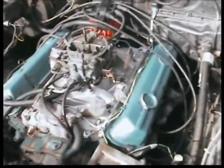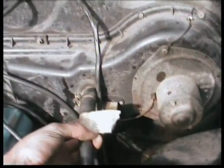We're basically unbolting the radiator now. It's compulsory to have a stubby of Melbourne nearby when working on cars! So we'll pull the radiator out. Another good thing if you're new to this — with all your wiring it's a good idea to label everything. You can see some tags I've done here: these are the heater hoses to thermostat, to water pump. I've got B positive for the alternator here, ignition ones, and just a basic oil sender unit wire — just so you know where everything's going and you can put it back exactly in the right place.